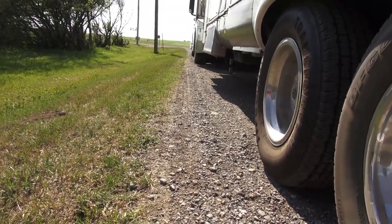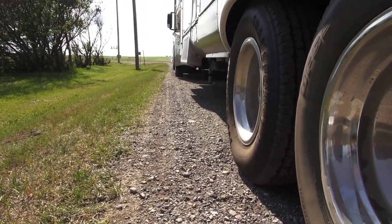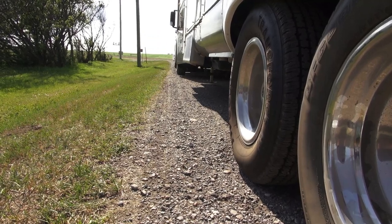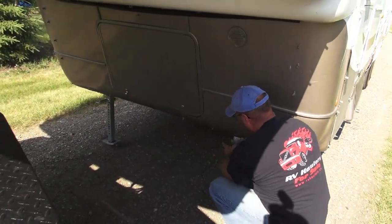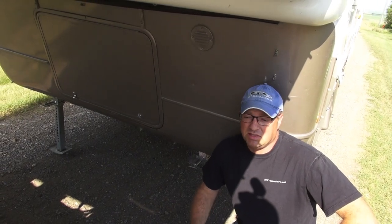This 2015 Volvo was really pulling pretty hard on that trailer. It's equipped with electric over hydraulic disc brakes, so I got some pretty good braking power with eight wheels in contact with the ground — it's pretty tough to skid. Lift your legs and make sure they're in the stowed position, then check your lights on the trailer: left, right, marker, brake, and backup if you're so equipped.